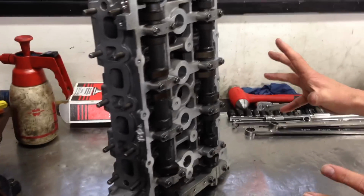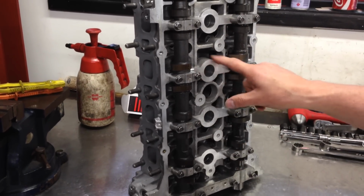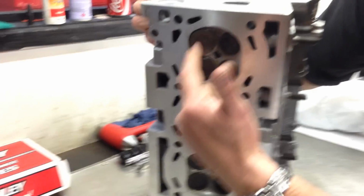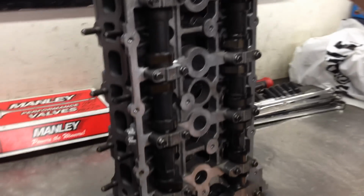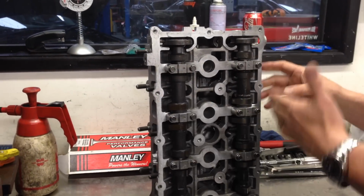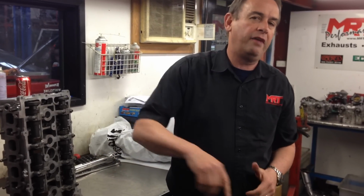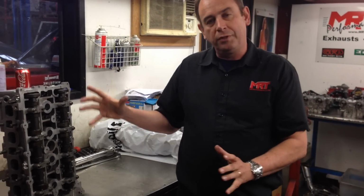Now I wanted to show you the head because the head on an EVO is really good. It's obviously a twin cam head. It's really strong in its design because it's got a lot of bracing internally in the casting of the aluminium. Of course, as we know, 4 valves per cylinder, 4-cylinder engine, and of course all of this is then driven off the bottom side here with variable cam control, so it's got variable inlet and variable exhaust. The original EVO 9 was variable inlet and variable exhaust. Prior to that, EVO 8 and onwards had non-variable cams. But I digress.